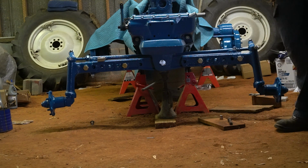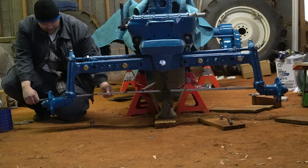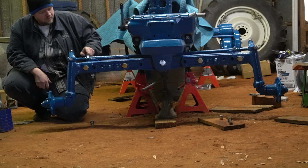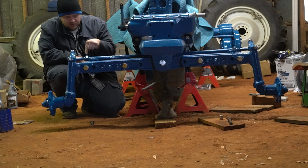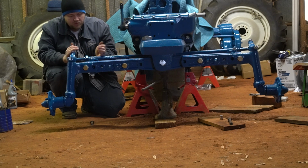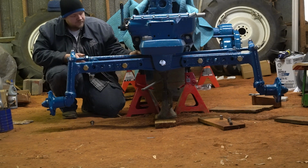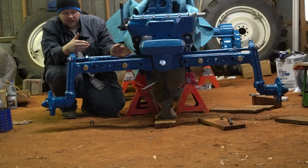Alright, so now I'll measure it again and see what I've got. And I have 62 1/16. So that basically didn't move anything. And since this one's already bottomed out, I'll probably go ahead and move this and then readjust everything. See, now that I have moved this outer joint 1 notch further in, to now lengthen this rod, I just have to spin the inner joint out, which will make the toe come back in if I need to toe it back in.